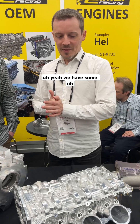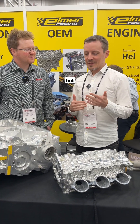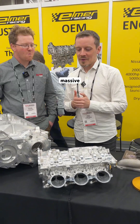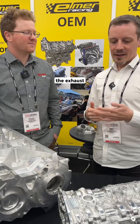We have drag-and-drive targets of 4000 horsepower, and that means we need quite a lot of cylinder pressure. But there's a limit on how far we can go with that, so we need a lot of RPM also. That's a massive issue typically — you end up with valve train limitations on how fast you can spin it.